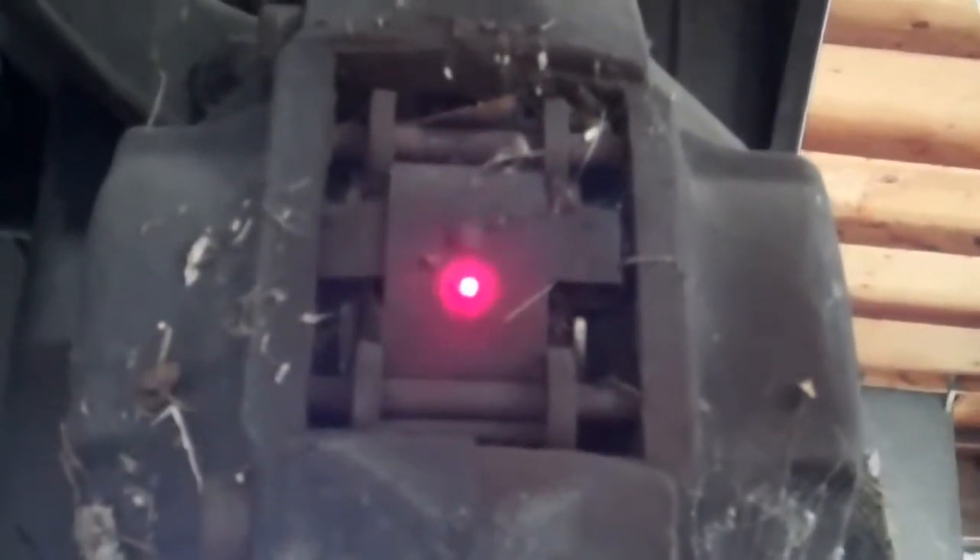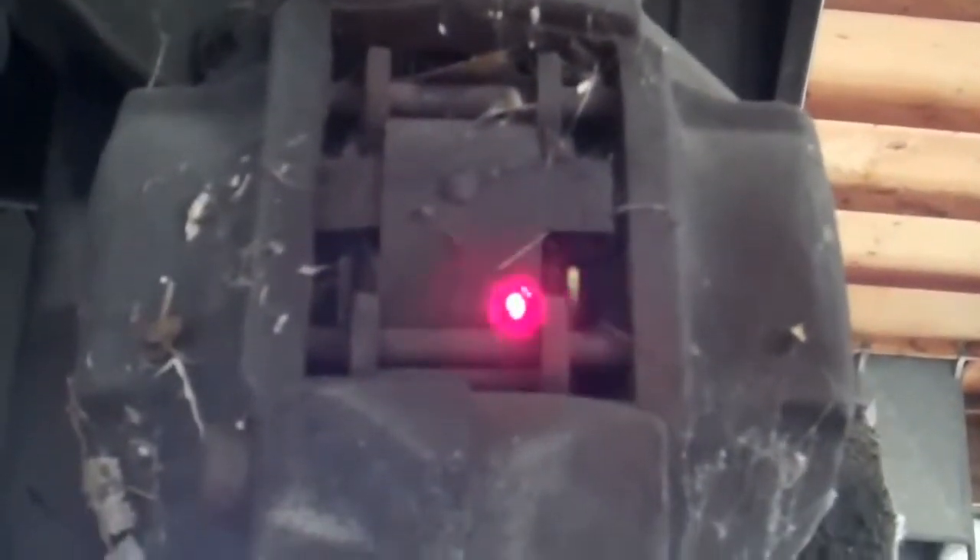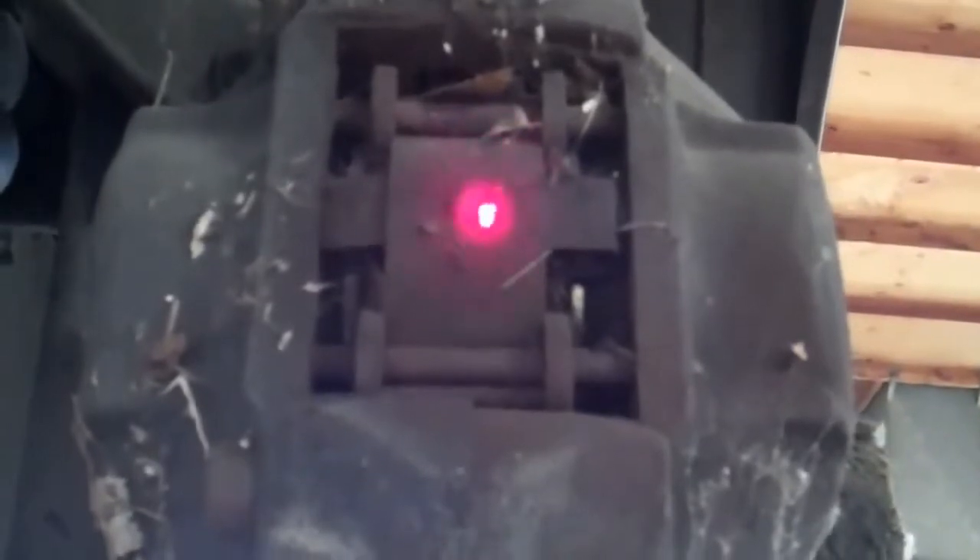Terry, we have the front of the car here and I just wanted to show you that the front brake pads are also finished. The wear plate right here — this is the brake caliper wear plate — and the brake pads are touching the wear plate, which means the front brake pads are finished. I would change the front brake pads as well when we do the brakes on the car. Both the front and the rear brakes are completely finished.